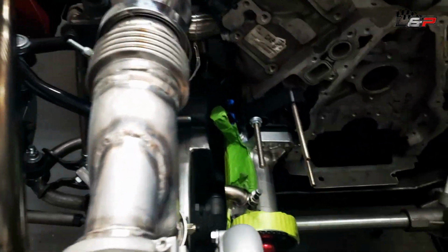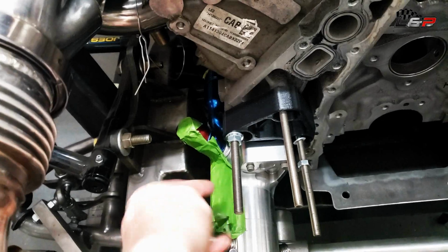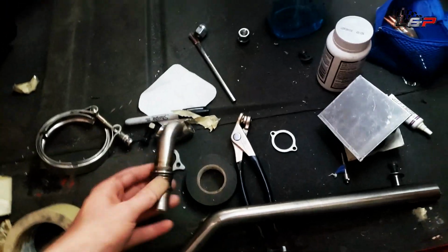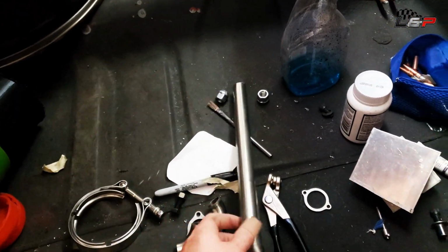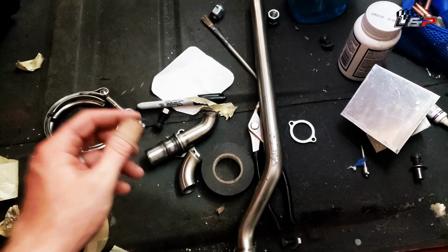In the meantime, what we're going to start working on next is the pickup tube, which is stainless. We're going to take this tube here, kick it down that direction, and pass it back that way so I can run a straight shot of tubing to it. I think I'm going to use a -16 stainless because it fits pretty well. This is some of the tubing that was left over from the original dry sump system, a lot of nice Wiggins stuff that we're going to cut up. So I'm going to use it for the bends, set up the purge, and we're going to purge all this and weld it up.